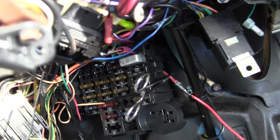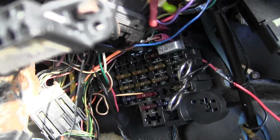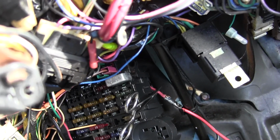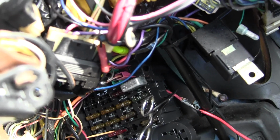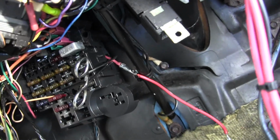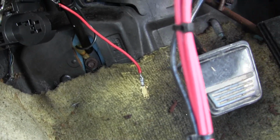But as for plans, I'm going to solder this, and then I'm going to put that into the first hole of the window power, WDO, PWR, and call it a repair once I paint and insulate that wire. I'm going to paint it twice with the paintable insulation and then a coat of electrical tape, and that should make it durable. And the wire is longer, so if I have to splice in something later, that's cool.